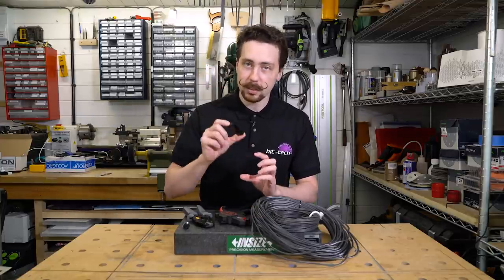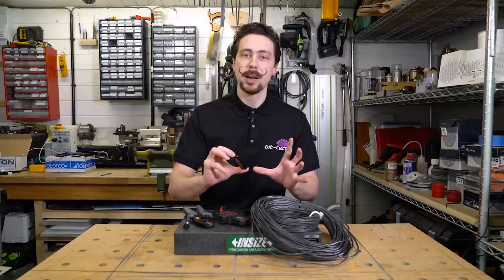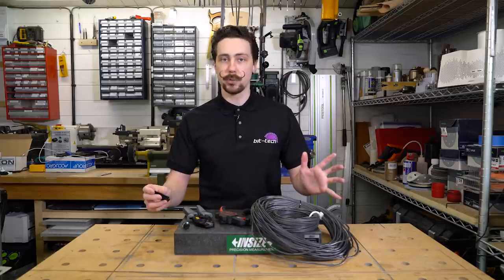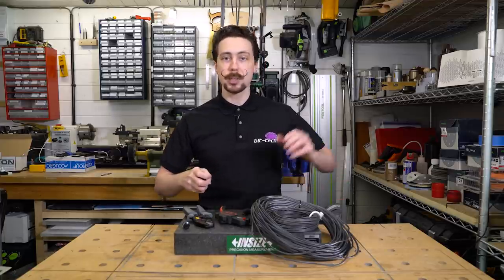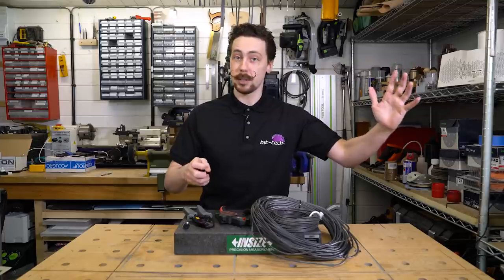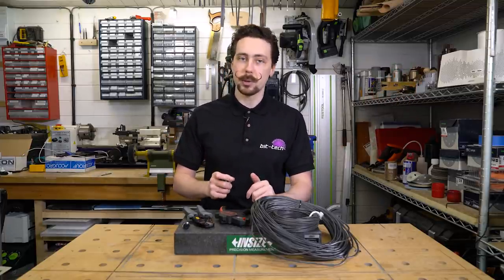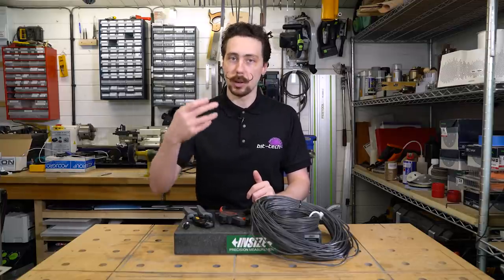Now, that's all well and good most of the time, but there are occasions where actually it's not ideal. If you're working with a very large case, for instance, and your power supply might be absolutely nowhere near where you happen to have to be able to view your reservoirs, that can prove a little bit tricky because you obviously don't want your pump to run dry.